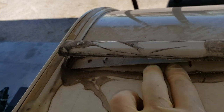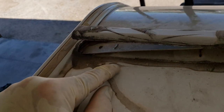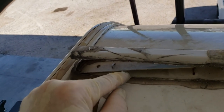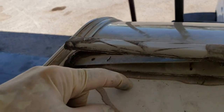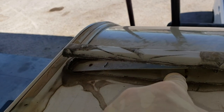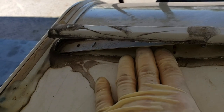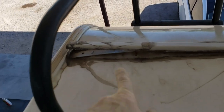When this roof was put down — this feels like a TPO-type roof — I would have liked to have put it over the top of the rear cap. The instructions actually say to do that. That way, when this inevitably happened, the rubber roof would still direct water over the top like a shingle. But because the roof is underneath, water comes in at the low point and goes straight down underneath the rear cap into the wall, which is why I like to put it over the top of the cap material on both front and rear caps.